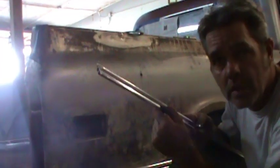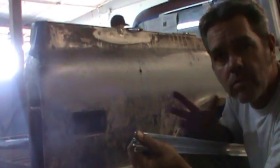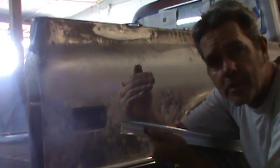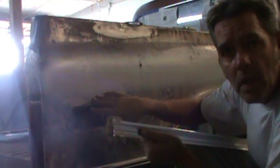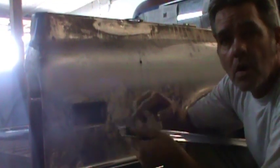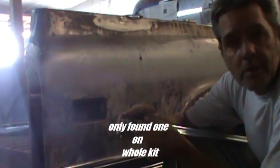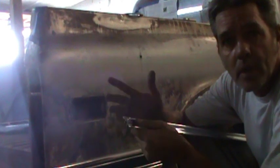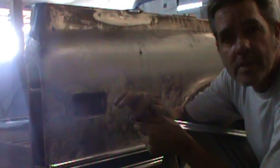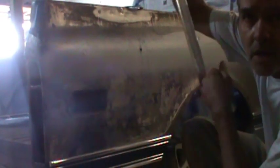So when you're installing these, look for minor little defects and holes that might be on them. A little piece of metal might be hanging down too much, and when you put it on your nice clear coat it'll dig right in. So look for any imperfections and do whatever you need to do to get rid of them. Typically I'll just use a 120-grit sanding wheel and lightly sand down any rough edges or any edges that might be sticking up.